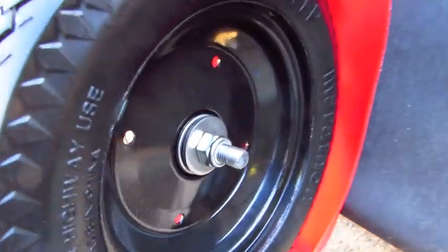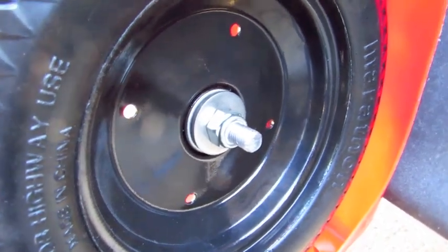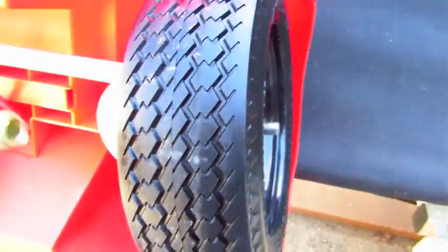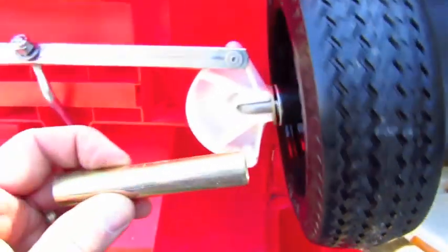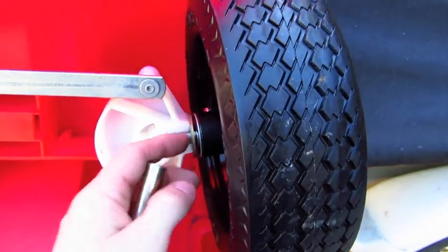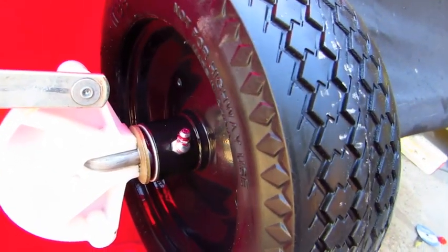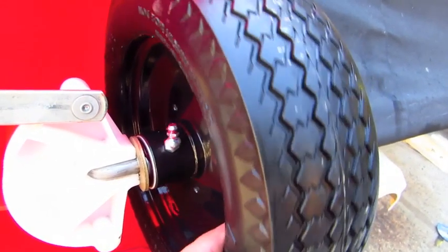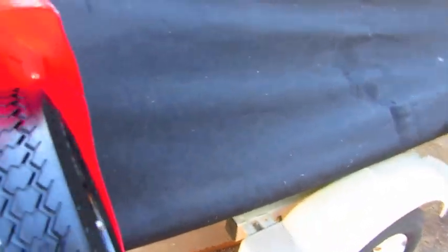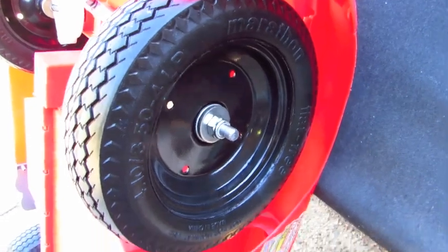What you're seeing is the original outer section of the spindle from the Power Wheels car, and the inside section where this actually spins on has this cut-down sleeve slid inside. There's a back washer here, and the neat thing is it has little Zerk fittings on it so you can pump the bearings. They've got nice little roller bearings on there — spins nice and smooth.